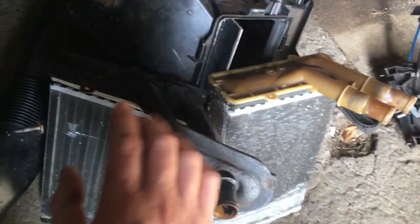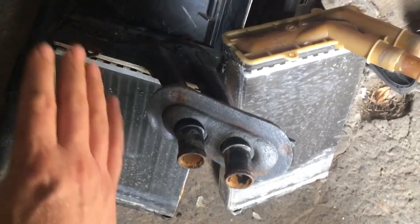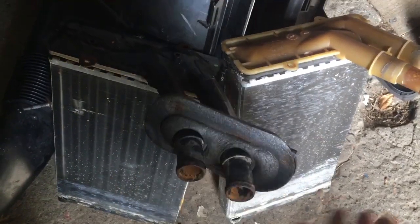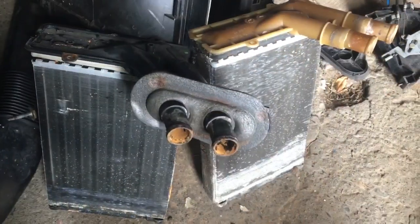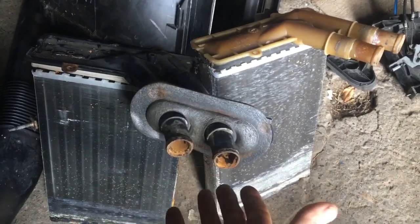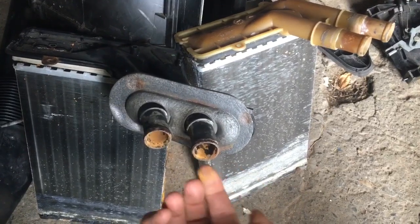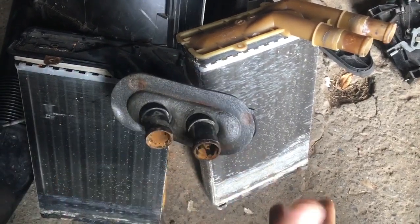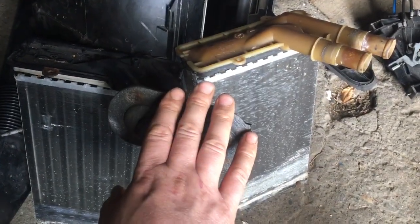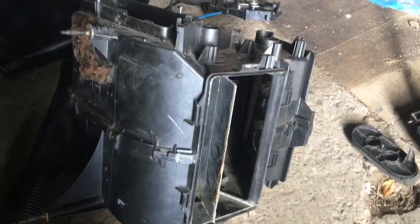I think I'm going to go with this one — it's from a B4 Passat. Before the car was broken for parts, I think about six months before that it did get a new heater matrix. I know they're not super expensive; I'm trying to keep costs down and it's not that I'm cutting corners — it's just that it is fairly new. There's a bit of corrosion there but I've flushed it, it's clean, and it's all ready to go. It fits in better, so this is my heater box.